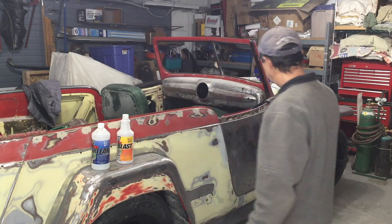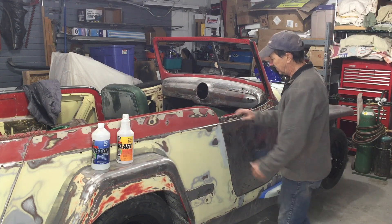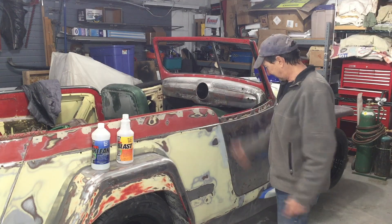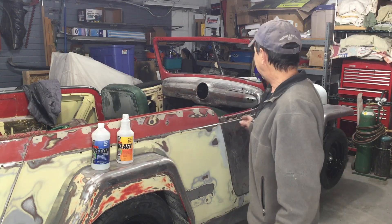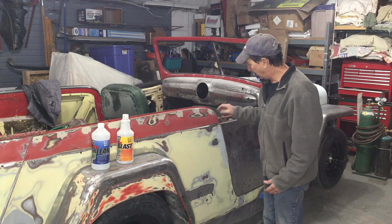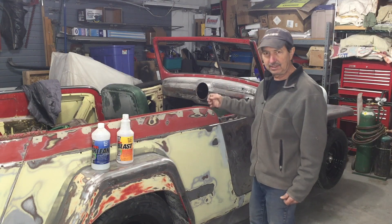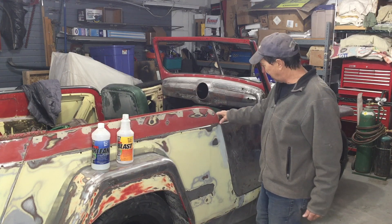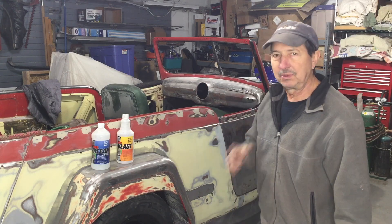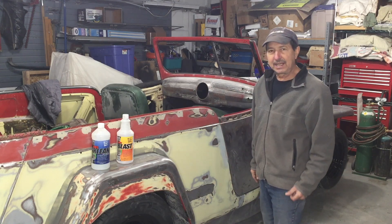I'm going to clean this metal and then show you how I coat this whole door — and it's another controversy. Some people say weld the door shut, fill across it, and grind out the weld. I've seen a lot of shops do that so you don't get movement because you don't have the foam in there to hold that door out. I jam something in there — a screwdriver, a chunk of wood, a piece of foam — just anything to hold it where I want it while putting my filler on. And I've got a cool trick to show you on how I put filler across those seams without filling them up and wasting filler.